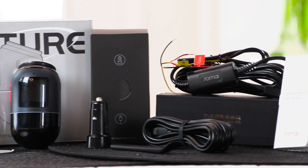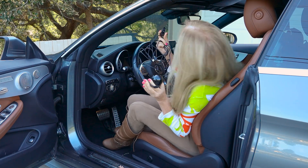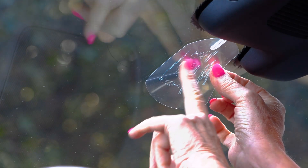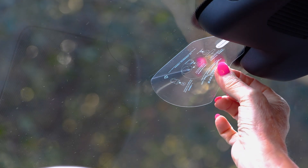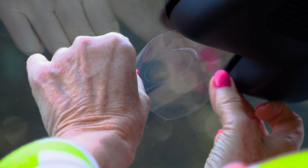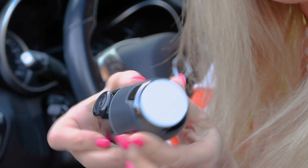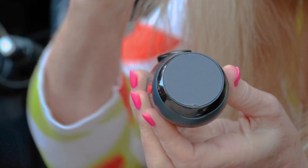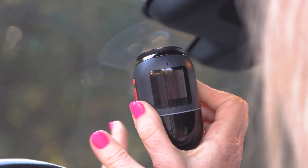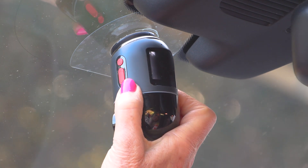I want to show you exactly how I installed my Omni. This is how easy it is to install the 70mai Dash Cam Omni. There is an electrostatic sticker — I just put this sticker on the area right under my rear view mirror. It had an indication so there would be a gap on the electrostatic sticker, and I had it face upwards. I made sure my area was really clean before installation. On the Omni camera underneath is the round part that sticks on your windshield, so you peel off the adhesive sticker there. Then I lined up my camera the way I wanted it viewed to the front of my car and pasted the dash cam on the electrostatic sticker right in that dotted area. It went on just simple like this.